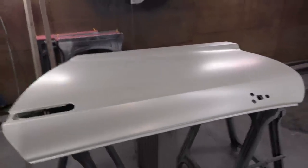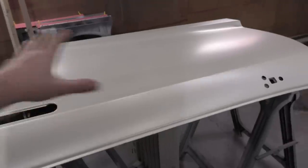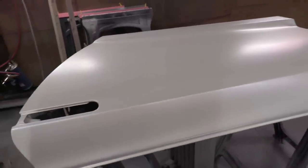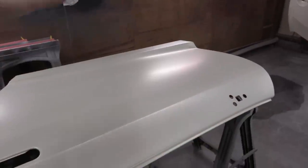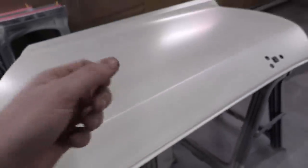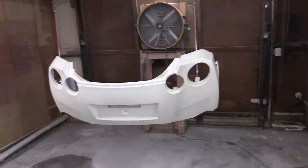It's time to go ahead and spray this paint. It's not the same brand as the other paint, but we are within what's called the respray window, so we don't have to sand it up — it will still adhere. But I definitely want to be very careful. You'll see me spray a little test strip of base coat over the existing surface right here to make sure it's not going to have a reaction, bubble up, or do anything crazy. I'm going to go over this quickly, clean it very well, and inspect it. Then with a piece of 800 grit sandpaper, if there are any little dust nibs caught in the paint, I'll sand those off. Then we're going to clean this with wax and grease remover one more time, and then you're going to see me spray the new base coat.